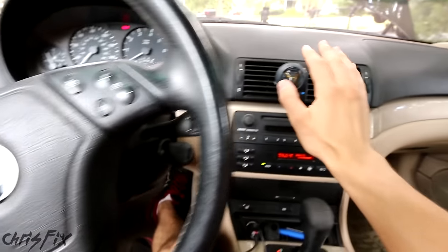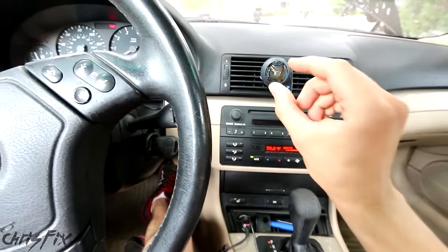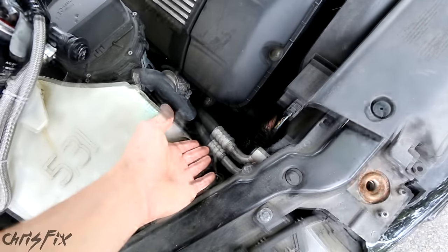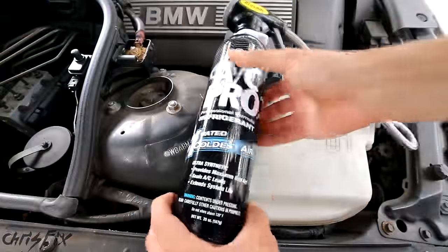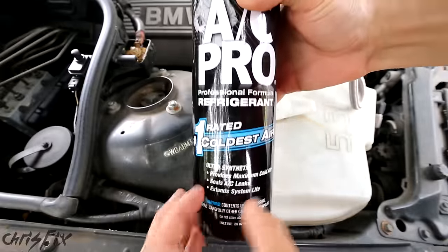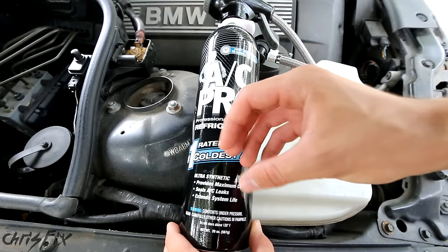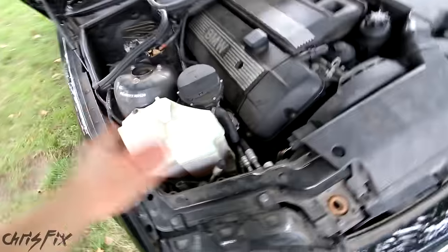In this car the AC system is not cold at all, and the owner told me a recharge lasts over a year. That means there's a really small leak, which is usually a bad seal somewhere, and it's not worth it to spend thousands of dollars to find the leak and replace AC components. So instead we're going to use a refrigerant that has a sealer in it. The sealer in this kit isn't typical — it's not a goo, it's not thick. It's more of a conditioner that conditions the rubber gaskets, so those gaskets and O-rings swell and clog the most common leaks.